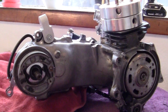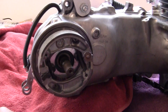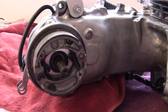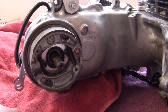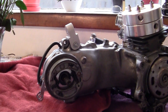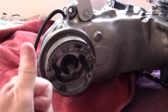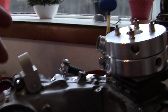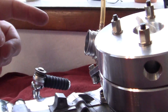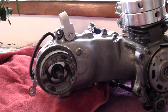Now that the brakes are built, we're going to tear apart the racing Mikuni carburetor and put the power valve on it, which is going to require some machining. I have all the instructions and everything to build it, but I've never built one, so you're going to follow along just like I am. The way the power valve works is that instead of wide open throttle where the needle valve pushes all fuel up into the carburetor, part of the fuel goes up through the jet and the other part is shot down through another jet.